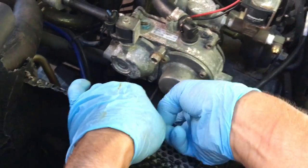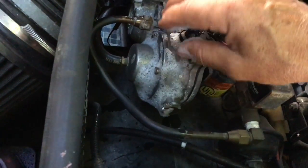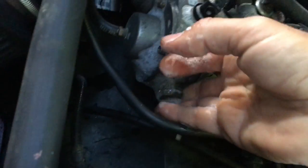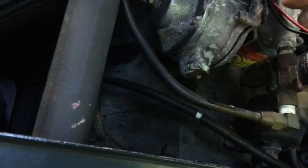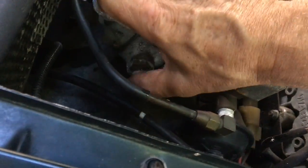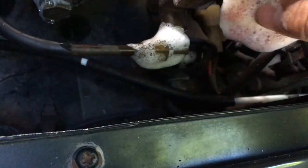Pretty unmistakable - you just have to take it off, superglue down that kinked edge to stop it coming up again. If you really want to be safe and check that you haven't got any gas leaks anywhere, you can get a solution of water and washing up liquid detergent, swish it around to get a nice lot of foam, take a handful of that foam and put it all around the joints you want to check for leaks. If you've got any gas leaks then the foam will bubble up - that's a good way to spot any tiny little leaks.